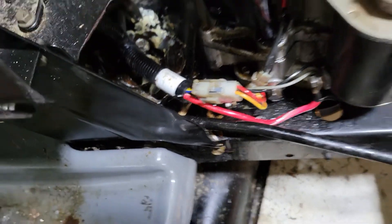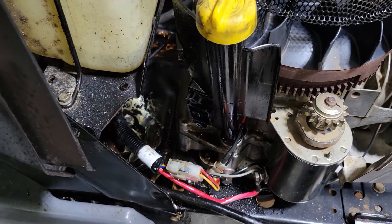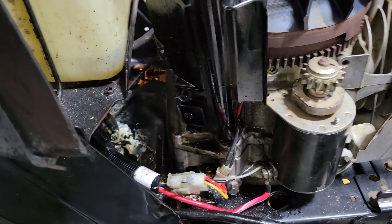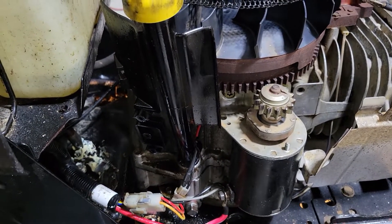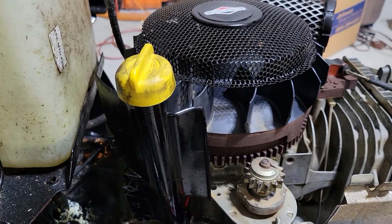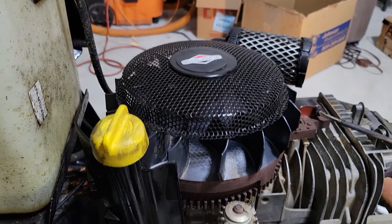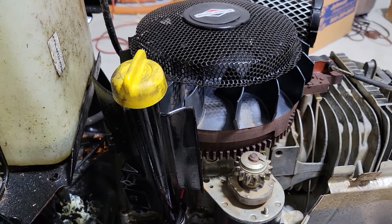I'm going to move the solenoid right here next to the starter where it belongs. I think it'll run a lot better too. I'm going to run 2-gauge wire from the battery up to here, leave the original wiring alone, and just run an extra wire to pick the solenoid and run the starter. This original starter doesn't have what it takes to spin this thing through a compression stroke. I've adjusted the valves as best I can and it still won't spin, so I've ordered a stronger starter — the ad says it'll run up to a 24-horse Briggs and Stratton, and this is a 17 and a half, so it should be fine.